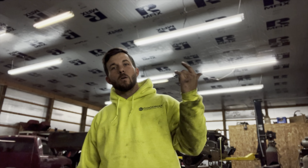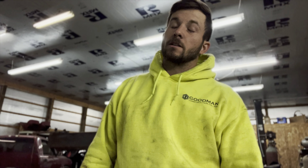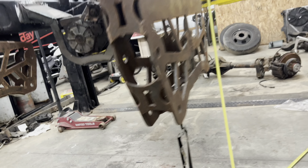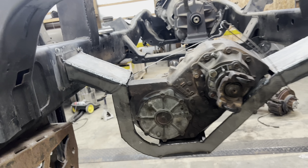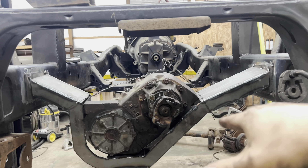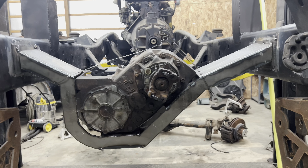By the end of that last session my phone decided to mess up, so I don't have any content up to this point other than that time lapse. I got all the parts cut out, got the transfer case built — all the bracing is welded up pretty much — and I've got it in the frame just mocked up for now with a couple of welds in every corner holding it. Ignore the tie wire — as you can see we're lined up good with the transmission, though it ended up with a little more tilt than I really expected.